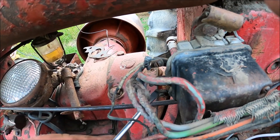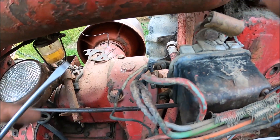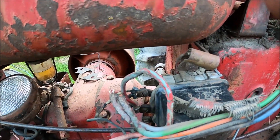That's all you have to do to hook up a single-wire alternator to make it work. You could hook everything into one terminal, which may be better, but it works. You're just using your regulator as a junction block — it's not working anymore as a regulator.